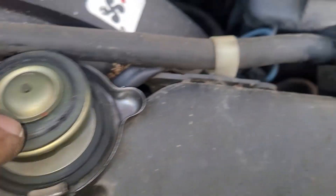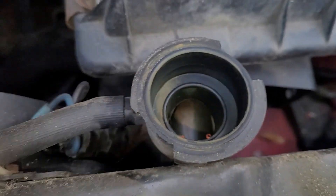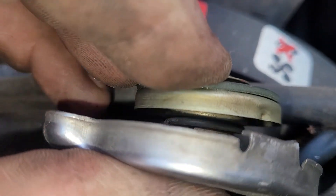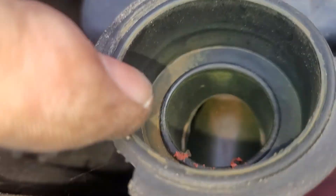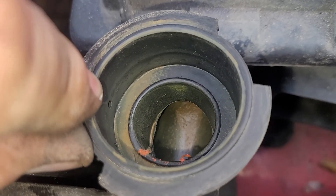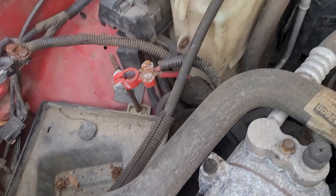This seal here rides up on this lip inside the radiator neck. That seals the radiator and allows it to build pressure. Once the pressure reaches 18 PSI, it will push that seal and spring, allowing the seal to come off the seat to open up the chamber. That chamber allows the hot coolant to go through that little port and follow the line into the overflow tank.